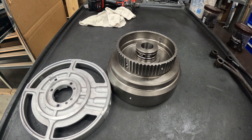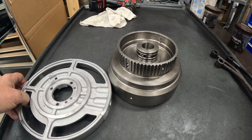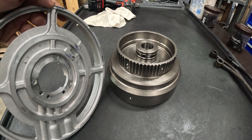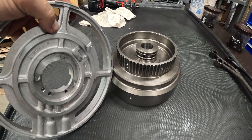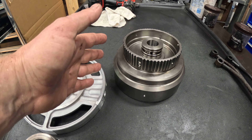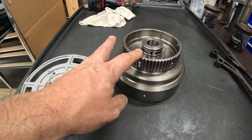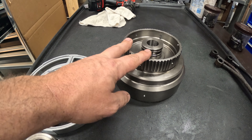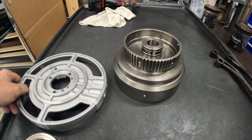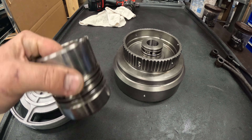You'll find pieces of the ball bearing but not the splines — that's what happens. This transmission was a recent rebuild by an unknown builder and he did not machine the center support. You can even buy a machined center support, but this is why it's critical — you have to do that, otherwise you wind up with much bigger problems. If this happened to you and you've got stock power, you don't need an $800 forward drum. You could upgrade to the full spline version but it's not necessary. What is necessary is getting a machined center support and a new bearing for your center hub.